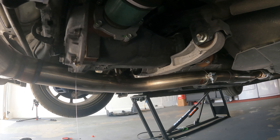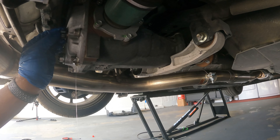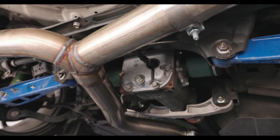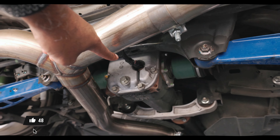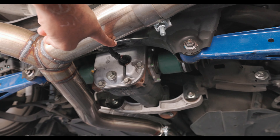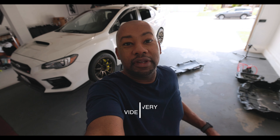So it took about a quart and a little bit more — about three pumps of the other one. Now that we're all done under here, got both bolts top and bottom torqued down to spec, which is 35 foot pounds of torque, and reconnected our diff sensor. All right Subie friends, it is getting toasty out here — we're gonna do the front tomorrow.